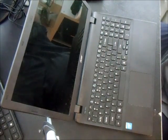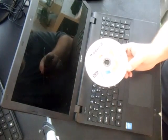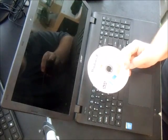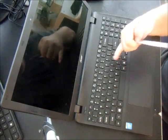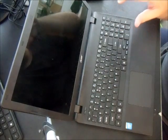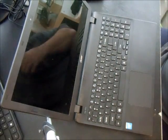You might ask about the operating system — it doesn't come with hard drives. You'll need to purchase a recovery disk. You can get them on eBay; this Windows 8 system recovery disk is universal with all versions, and I got it for about seven or eight bucks. The product key license is actually embedded in your BIOS with these computers, so you don't have to pay for a new operating system. I'll post at the end of this video how to retrieve that product key and how to install.